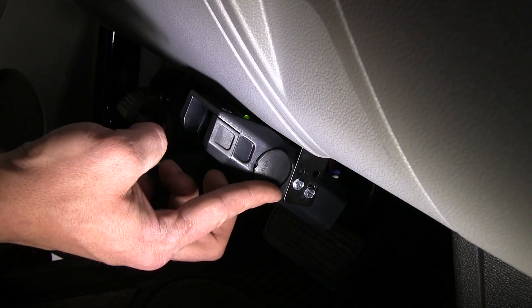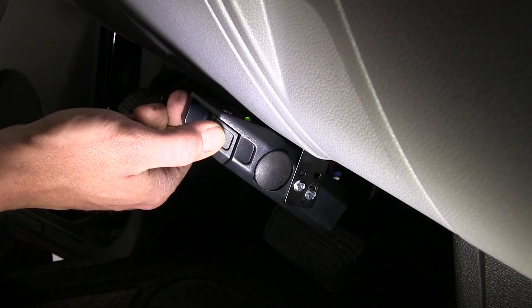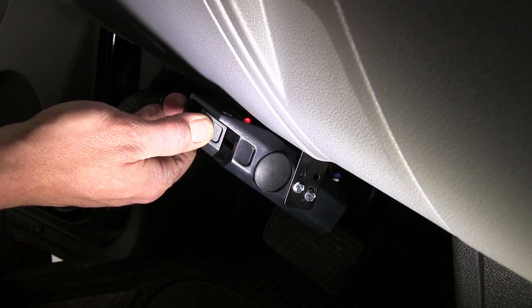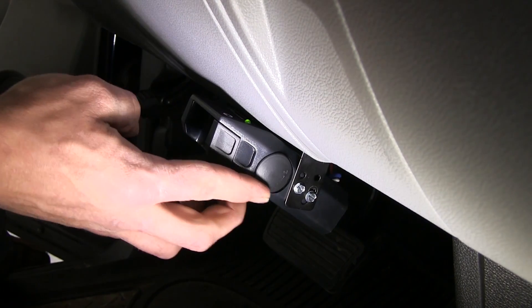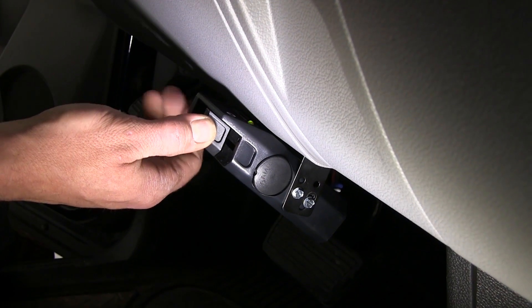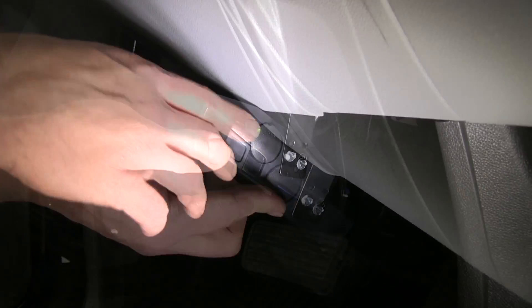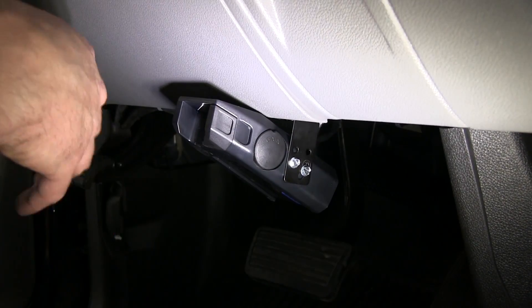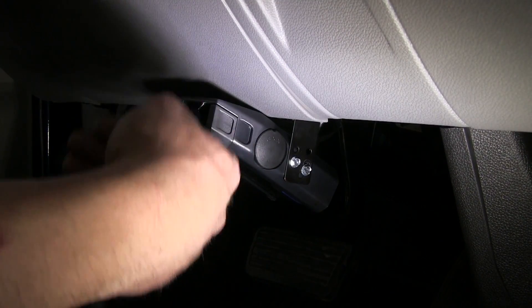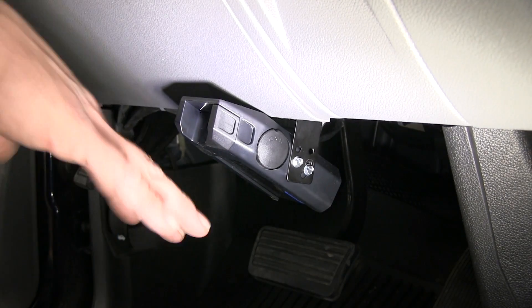It is fully adjustable on the side to turn your gain up and down. With full gain, we have a dark red dot. As you draw that gain down, it turns to a yellow color. The adjustable gain allows you to adjust the amount of braking power going to the rear in relation to the weight on your trailer.